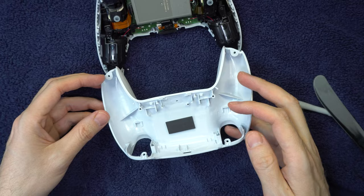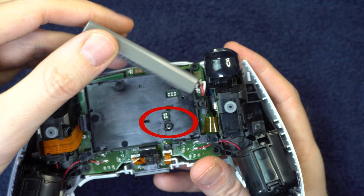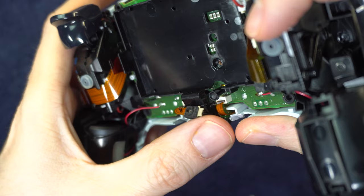At this point in the process, I recommend you take a photo and keep taking photos throughout as you disassemble further. Tip the battery up to reveal another screw and remove that one. Underneath the battery compartment is a microphone — you'll need to slide it out of the slot. There's a little piece of ribbon on the right of it; push on that and it'll slide out. Just leave it hanging. You can now remove the battery compartment.